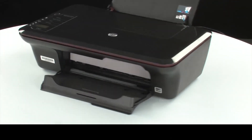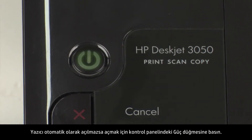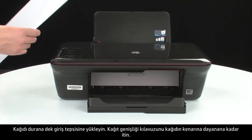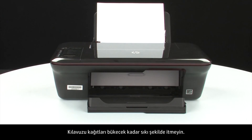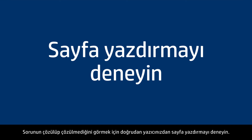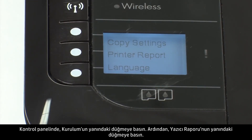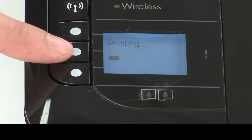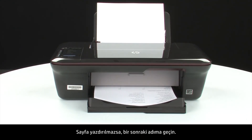Move back to the front. If the printer does not automatically turn on, press the power button on the control panel to turn on the printer. Load paper into the input tray until it stops. Slide the paper width guide inward until it stops at the edge of the paper. Do not push the guide in so tightly that it starts to bend the paper. Try printing a page directly from your printer to see if the issue is resolved. On the control panel, press the button next to Setup, then press the button next to Printer Report. If the page prints successfully, the issue is resolved and you can reconnect the USB cable and resume printing as normal. If the page does not print, go on to the next step.